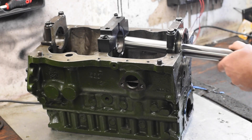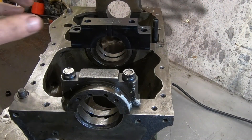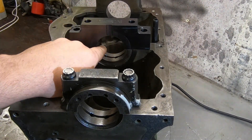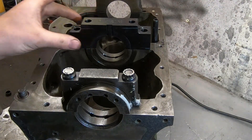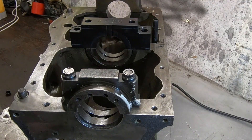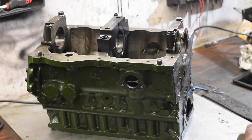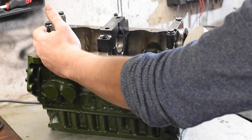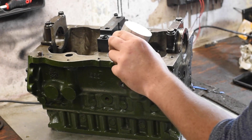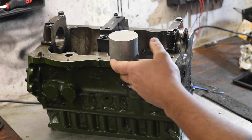If I take this bar out of here you'll be able to see clearly that this bearing cap has a significant lip — that's because this bearing cap comes unmachined and has to be machined to match the bore in the block. Before we can do that, we're going to need some bushings to run this line boring bar in this block. I'm going to produce those bushings from some 60mm H30 aluminium bar that I have here.